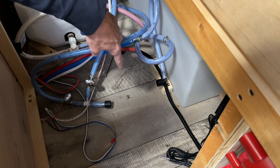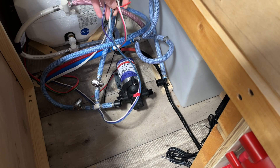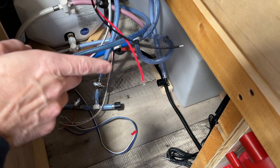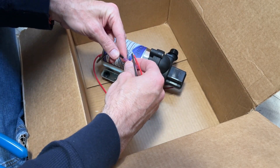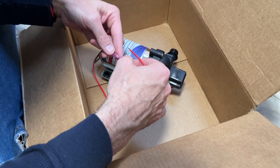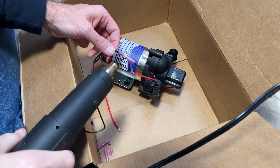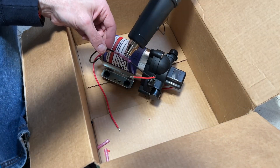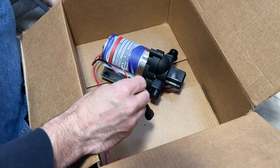I'm out in my camper, under the bed — this is where the water pump goes. The pump will be mounted here, and it already has fittings, so I'm just going to reuse them. Here are the positive and negative wires for the water pump; I'll be splicing into those. I have power off to the water pump while I'm working. I'll crimp connectors onto the pump wires and also onto the camper wiring. I have these stripped back about a quarter inch, insert them into the butt splice, then crimp. I'll do a tug test. This is heat shrink tubing, so I'll use a heat gun to shrink it down — it has glue in it to seal it up. So we have that crimped up now, and I'll do the same to the positive and the wiring in the RV.